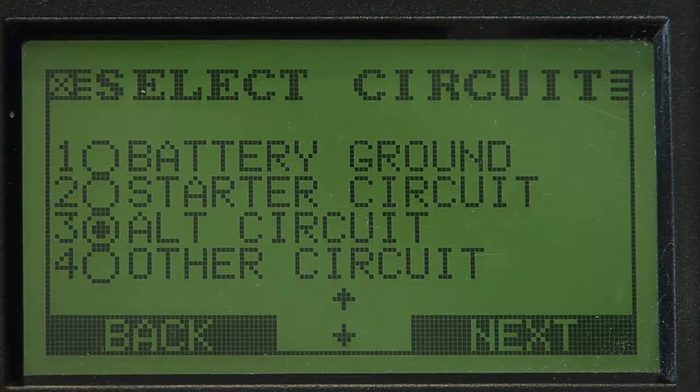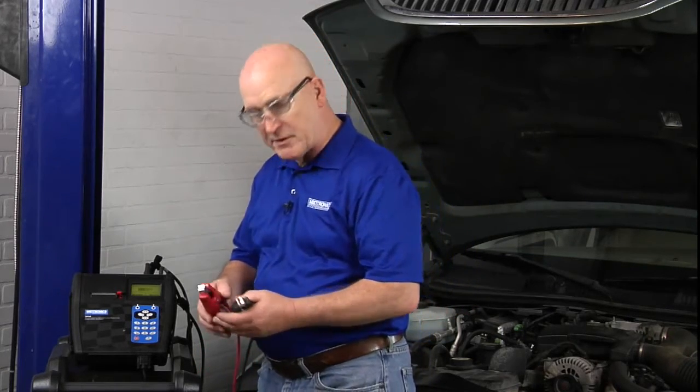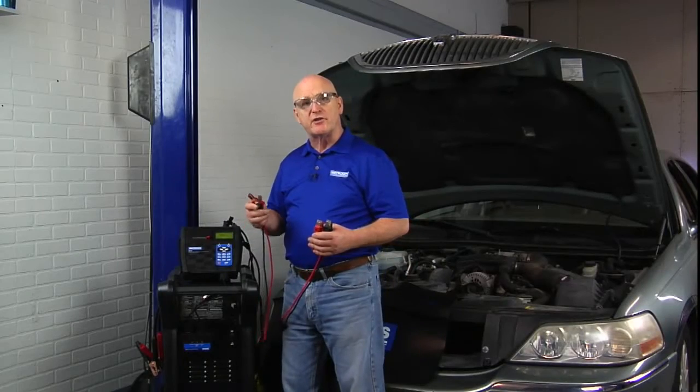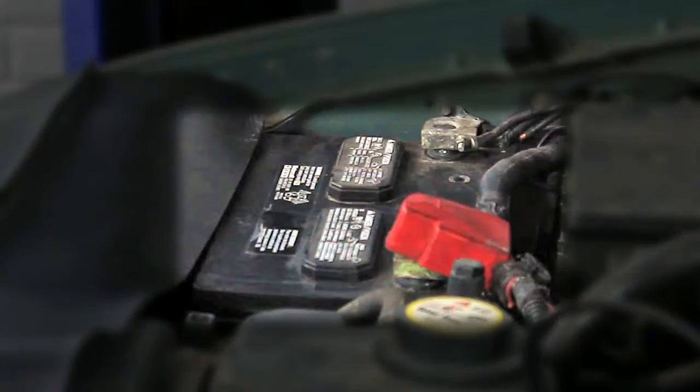We're going to show what the cabling is from that alternator. When I select that, it's going to default to 80 amps. That's an arbitrary number — if you have a different number that's appropriate for the vehicle you're working on, that's fine. But 80 amps is assigned as a generic for automotive applications. We're going to take the battery test clamps and hook them up at the alternator, and we've got a separate set of digital multimeter clamps that we'll plug into the top of the module and hook up at the battery.